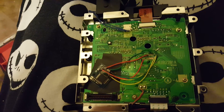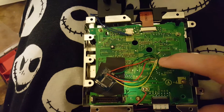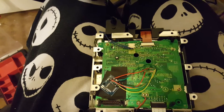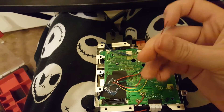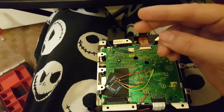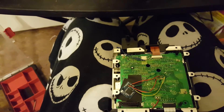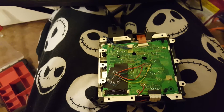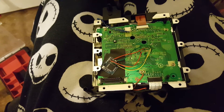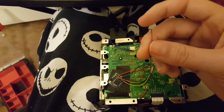The Xeno GC is already installed. I used wires to do it, which I strongly recommend you do as well. Even though this mod chip was made to be soldered directly on top of it, using wires saves you a huge amount of time and effort. It's really important that the wires you use are bendy — really easily bendy, not stiff. These ones came out of a broken third-party original Xbox controller. If you have a broken GameCube or Xbox controller laying around, pull that apart and use those — or use AV cables or any bendy wire you have.